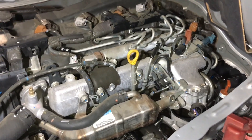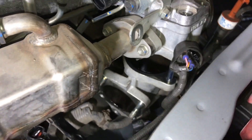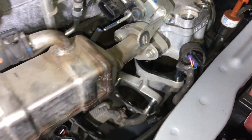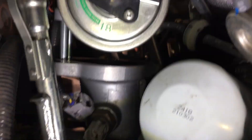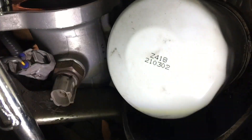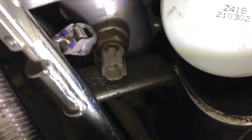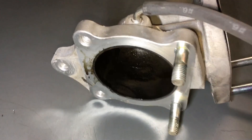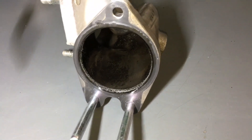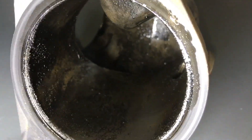There's like two of us working on the vehicle, it's 10:30, we've been going all morning and haven't made a lot of progress. Just trying to get this EGR valve out, and the dipstick's in the way — looks like we're going to have to pull the dipstick. There's no issue with any of these components — they could do with a general clean-up. This is the sort of thing where you can spray intake cleaners like D-Carb — those products are good for cleaning very light build-up. Any heavy build-up, you need to get in there and scrape it, clean it, wipe it.